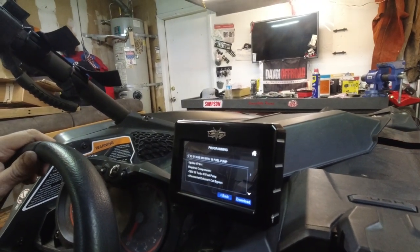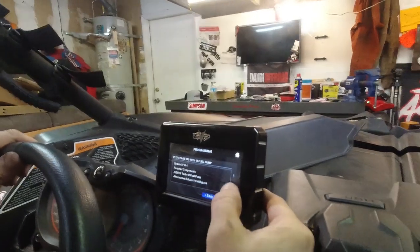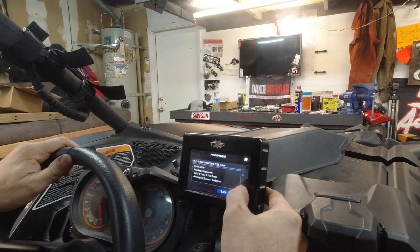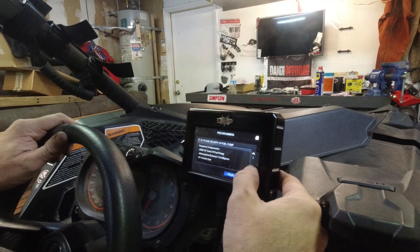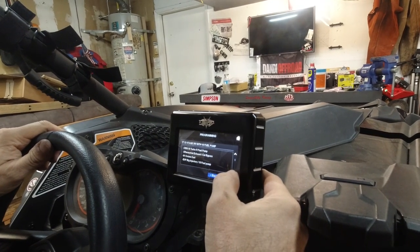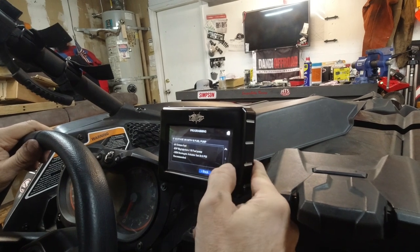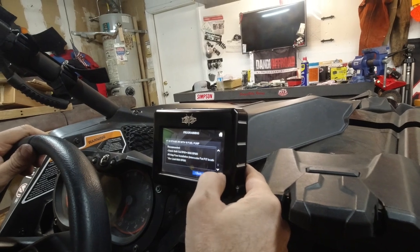Here's all the requirements. Required components: OEM 18 turbo R fuel pump, we have that. Aftermarket exhaust cat delete bypass, we have that. 91 octane fuel, we already had that. EVP big injectors, 18 fuel pump, we have that. OEM wastegate actuator, I put that back on. It is set to 8 PSI. Recommended clutch, the clutch settings are probably at least in the ballpark.